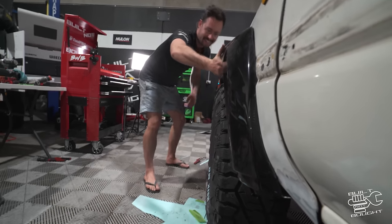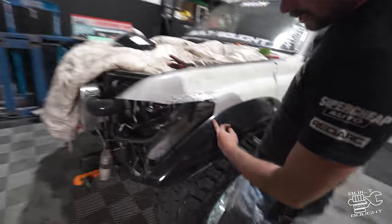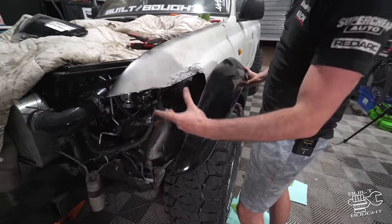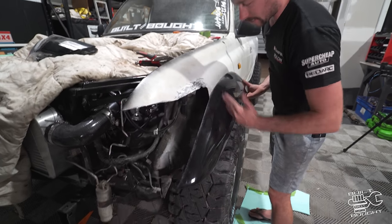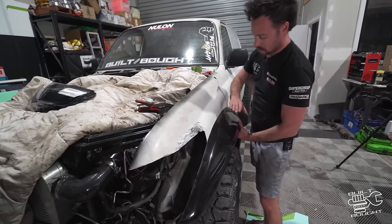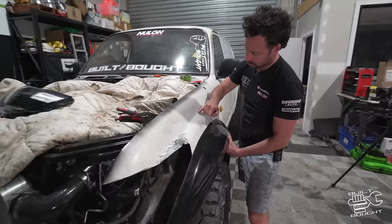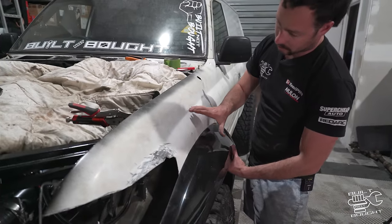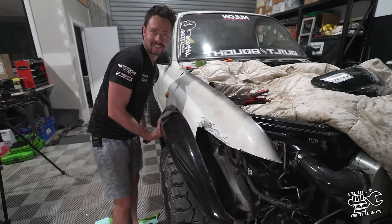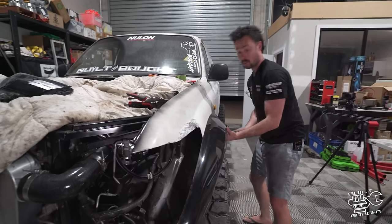I'm actually super impressed with these flares — bang on, and not even cop bait. We'll trim this straight down to give clearance for the headlight. All this section will go in the bin because the bull bar is going to come around here anyway. Then we'll mount the flare with sticker and glue, and build up from that section to the crease to give enough bulk to really come into the headlight and shape around it.